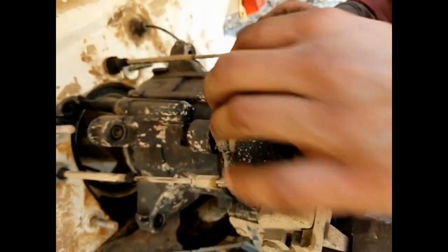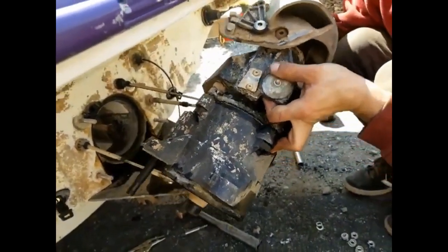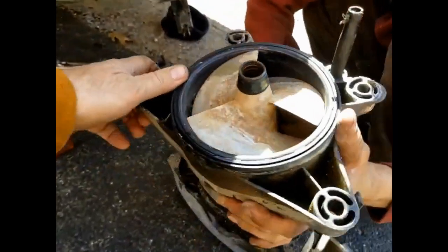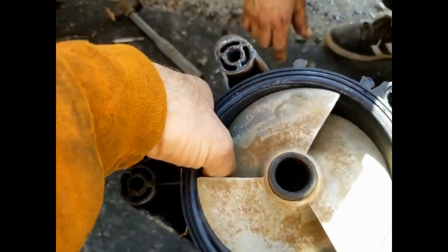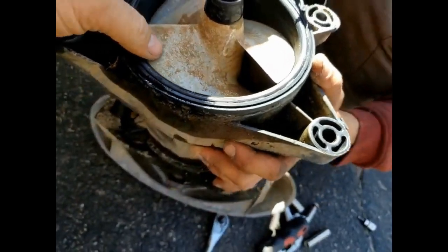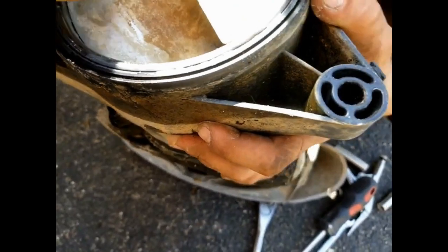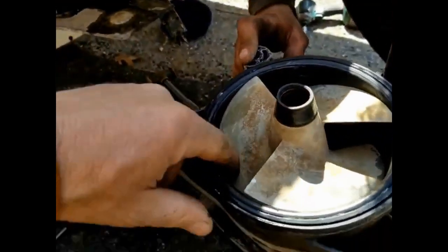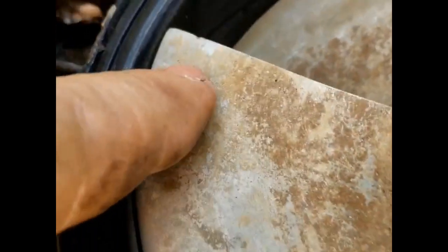You've got to take that off too. You've got to get that out like that? Don't break it. The wear ring. Let's see what prop is in it. The prop really doesn't look that bad. The wear ring's not too terrible. My guess is they put the wrong prop in it — the way that thing was getting on plane, just for a few holes in that impeller. Look at that right there. It ain't even that. There's a couple of gnarly holes in there but I just don't think that's it.